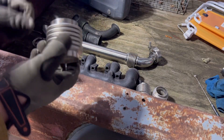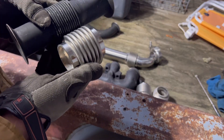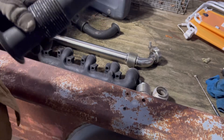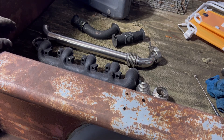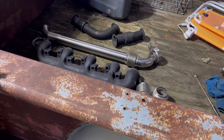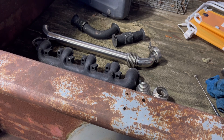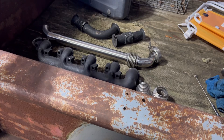I may try to find some more compact bellows, because I ordered these under the impression they were the smaller ones, not these giganto bellows. So I think I'm going to probably end up ordering another set of inch and three quarter bellows, the tight ones, and swap these out. So that's where we're headed with this. The T4, I have to order yet. I'm going to order another S300 turbo to do this. This is the beginning stages. I still have to figure out how the oil drain is going to go into the valve cover — I have a rough plan, but I'm not 100% there yet. So this is what we have: a whole pile of manifolds, pipes, pieces, and parts.